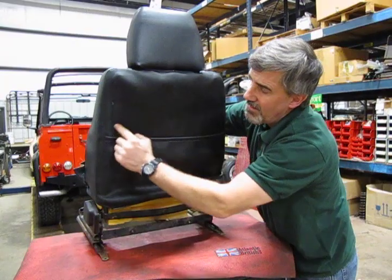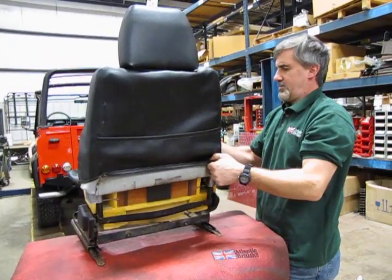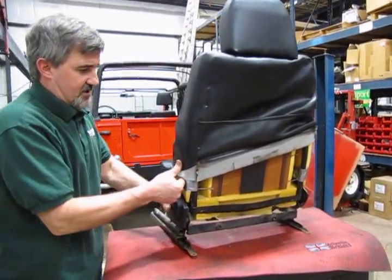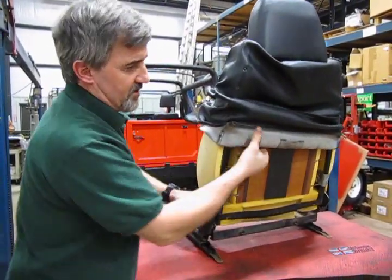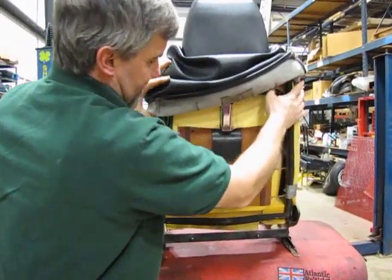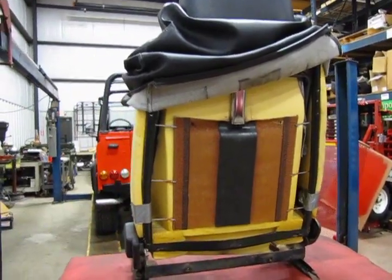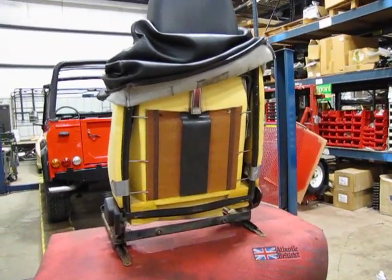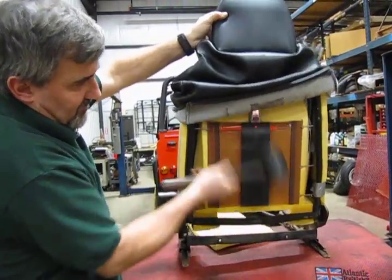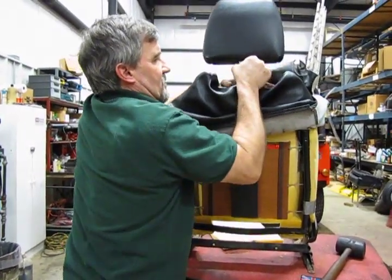Some vehicles will have a plastic hand pull on the back of the seat, which is held in with just two Phillips screws — simply take those out. The headrest inserts down into the seat and is accessible from underneath. The easiest way to get the headrest out, especially if it's older or has been together for a long time, is to use a rubber mallet at the bottom of the headrest slide — because you don't want to damage it — and just simply tap up. Once you get it started, it will lift right up and out.